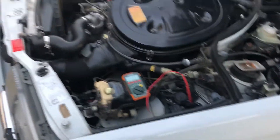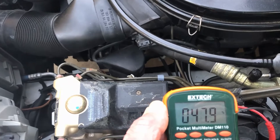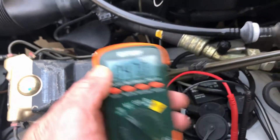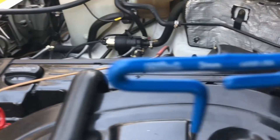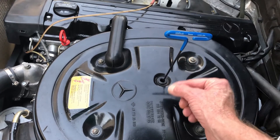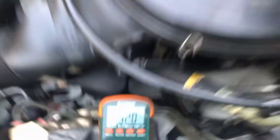Got to warm up some more on the test drive. Adjusted the duty cycle — now it's about right on. From what I understand, you get this 3mm Allen key. The key goes down into a little Allen. You push down — it's on a spring. Not all the way down, it will kill the engine. You turn it right to richen the mixture, and left to lean it out.